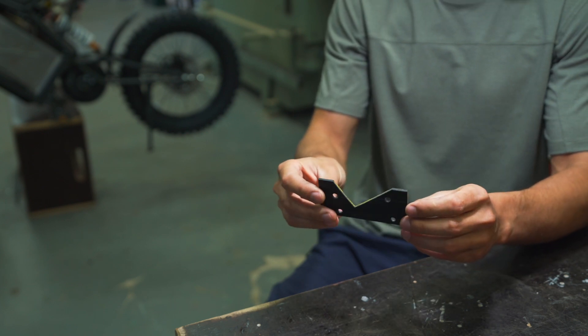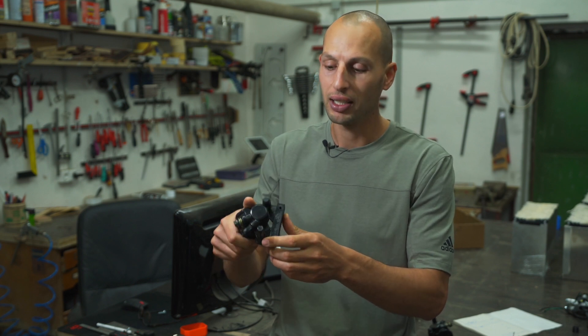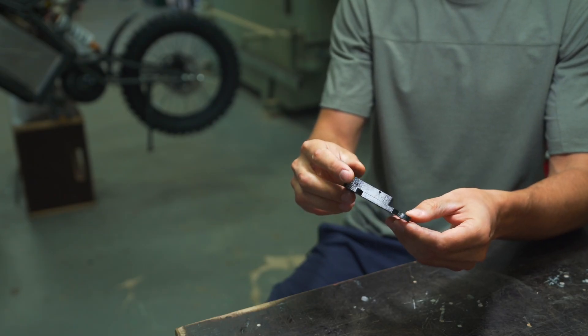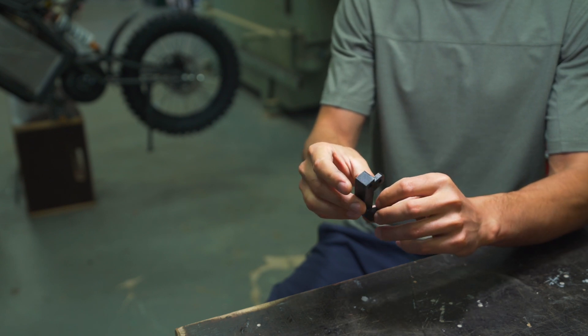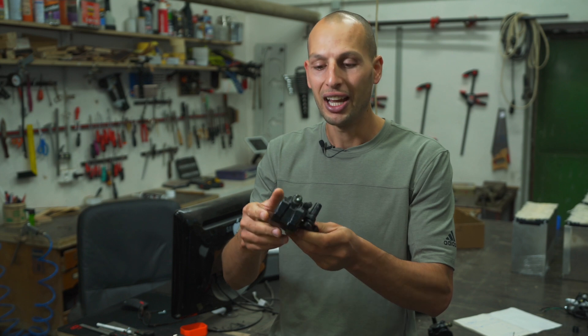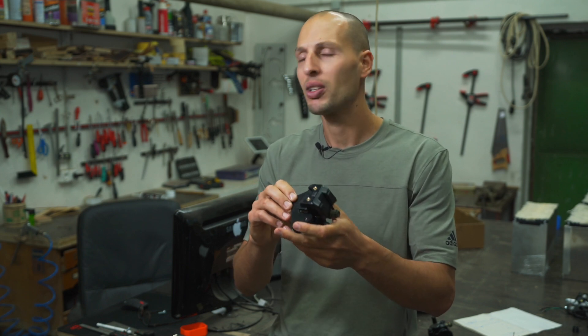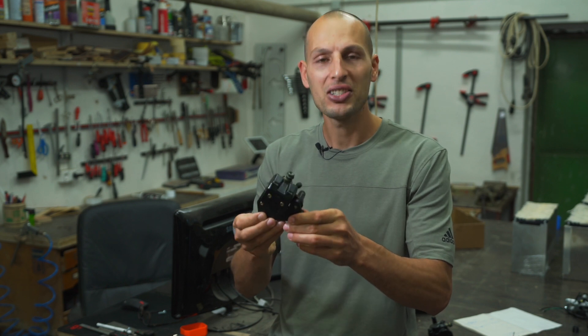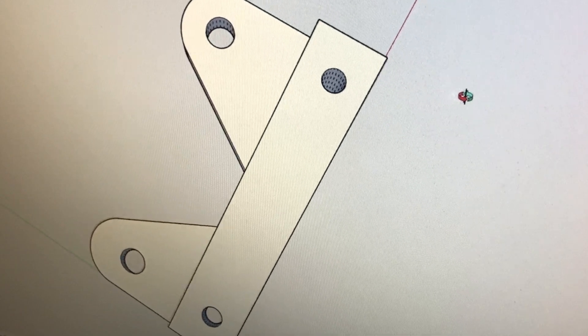We confirmed the caliper can move freely the way it's supposed to. Then I modeled and 3D-printed this plastic mount and adapter, cut the thread into it, screwed it onto the caliper, and mounted it on the bike. This plastic adapter is an amazing help — it's printed within 40 minutes on these Prusa printers.